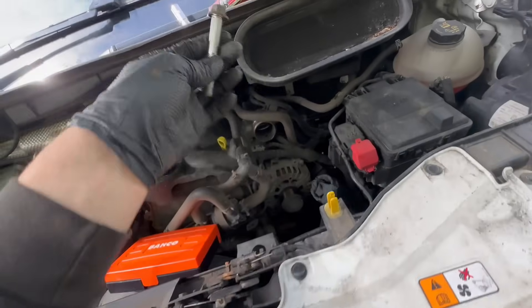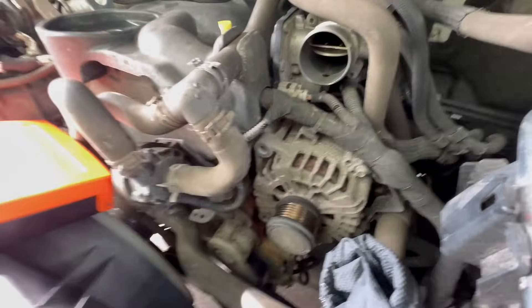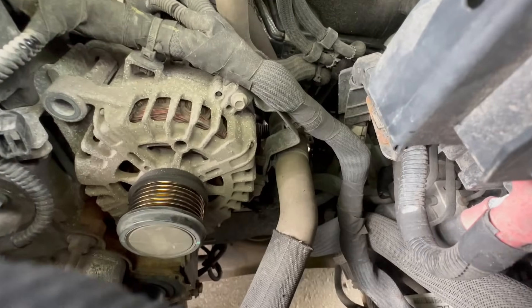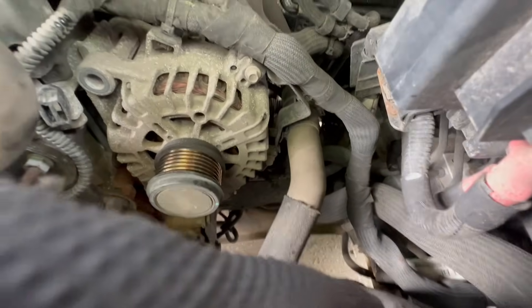The two bolts are removed — you can see the bolts there. We just need to get a lever bar in there and prise that open. We'll also need to remove that 8mm bolt there, a couple of cable tie connections, and we've also got another 8mm just down there. Fairly simple — let's just get it off and we'll get back to you once it's off the car.